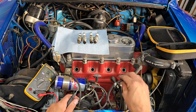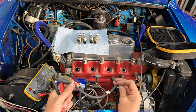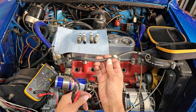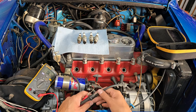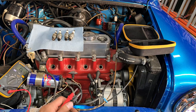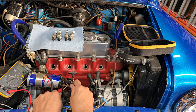Pretty much standard fare for wires — I wasn't surprised, these are a Bosch brand. Still in pretty good shape, although they are starting to hold their set. Next up I need to check the coil. With all wires removed, this one's showing 1.2 ohms — that needs to be replaced because this should be a 0.8 ohm coil. So yeah, definitely needs a coil.